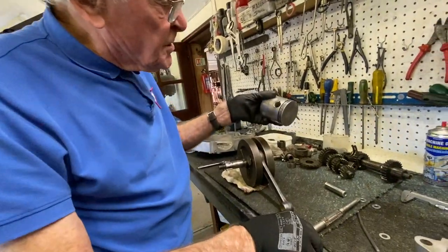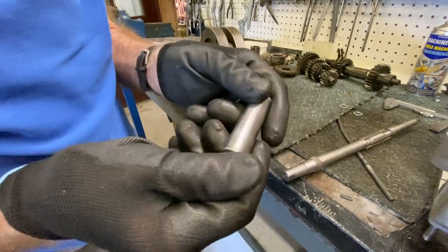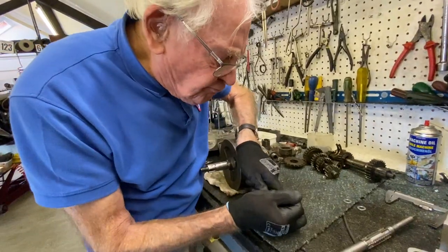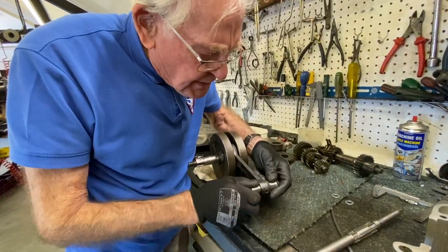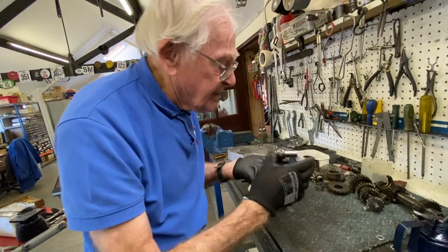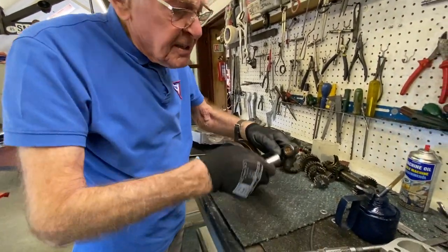The same applies to the piston. When you get the size of that, you run the reamer through the piston. So we've got the new pin, new gudgeon pin, a bit lucky. So we'll just try that. And that's a relatively nice fit. Just touch it. Maybe in the, yeah, that's not too bad in the middle. See, that's nice and free. Bit of oil helped the job along. The oil supply for the small end, when it's splashing around in the crankcases, the oil gathers there. So that's nice and loose now, you see.